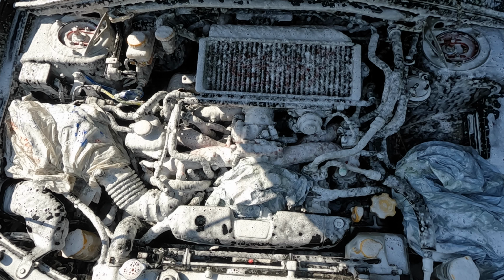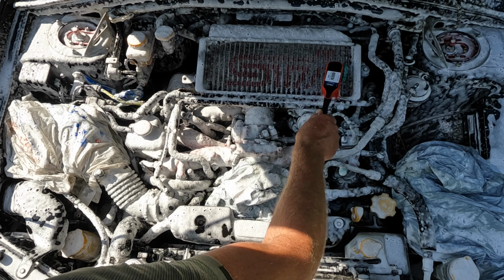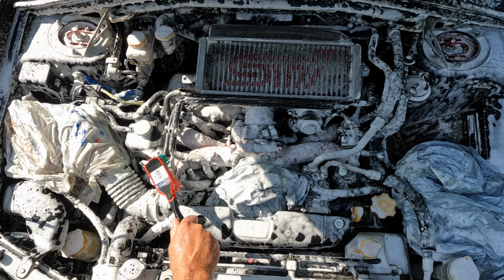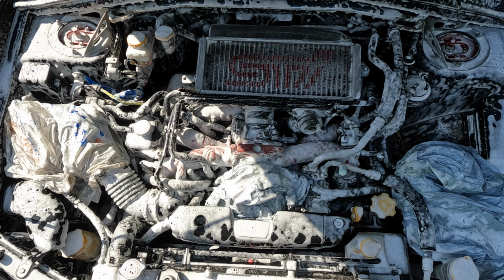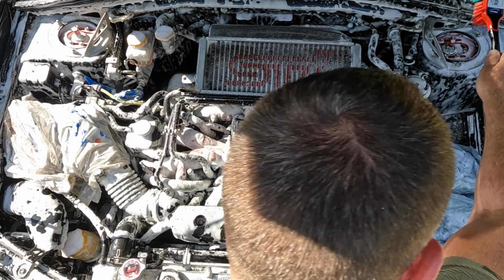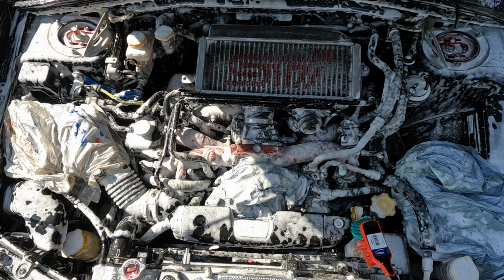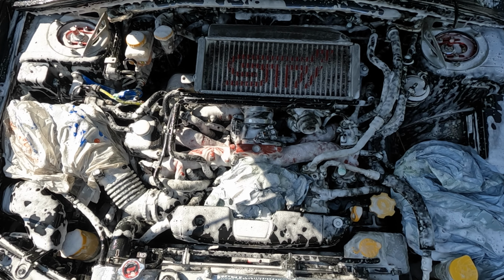See, it goes on quite well and it comes out quite lively, really. I think I made a bit of an error with the dilution ratio. This was 90 mil Green Star and 810 mil of water, so it's one part Green Star, 10 parts water. And then we're just going over the dirtier areas with a Vikan brush.